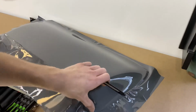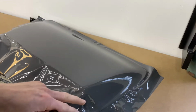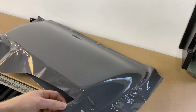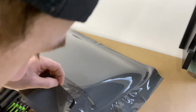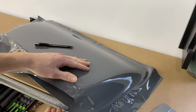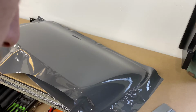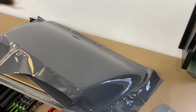Okay, now because I'm right up to, almost up to where my knifeless is, where I ended my inlay, I'm gonna take and make a cut here. So now I'm also gonna take and make a relief cut right here. So I'm gonna heat this up and I'm gonna stretch this down into where my inlay is there.